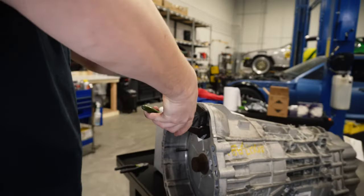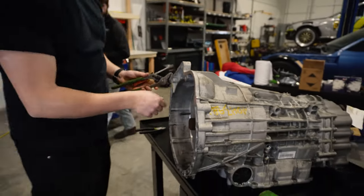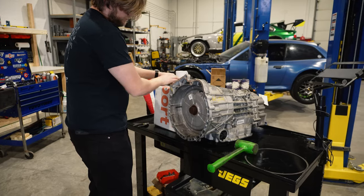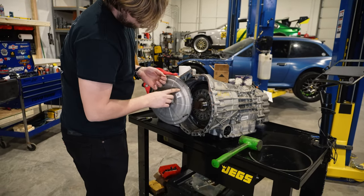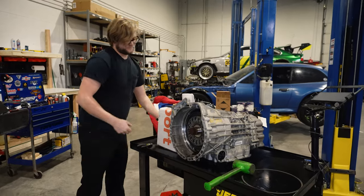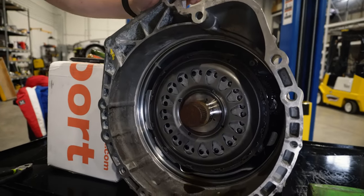Put the pliers on, grab your screw, and put a screwdriver and pry against the housing. Now the cover's just going to come off. Note the arrow on the cover — that's going to face up when you put it back in. So that's the factory clutch — nothing special, just a clutch.